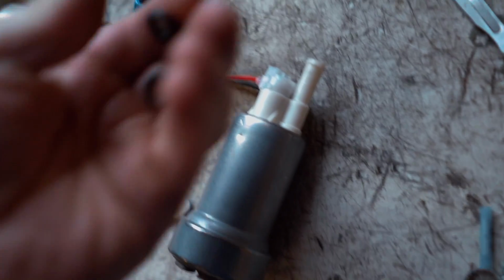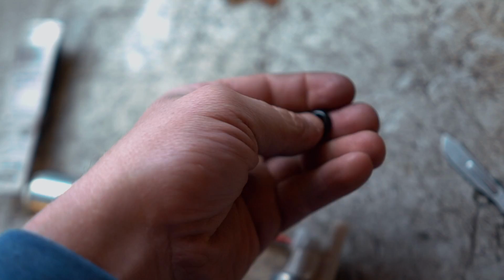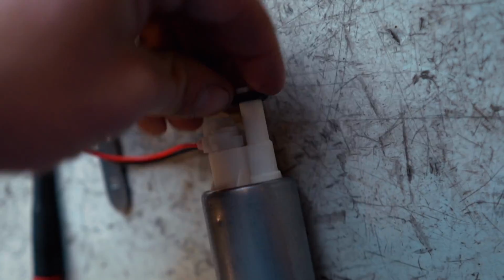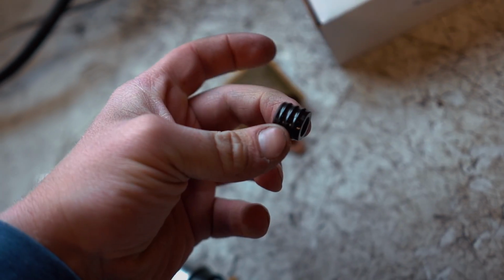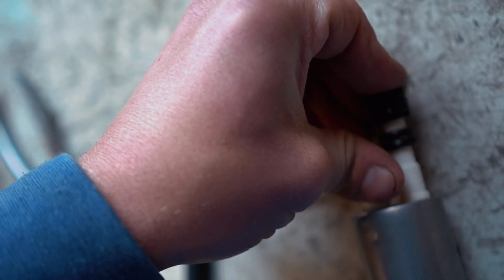So the next thing to do is take 2 injector O-rings right here. I'll try to find this exact size and link them down in the description box below. I'm gonna slide them over this right here. Should be a pretty tight fit. There's 1. Now grab number 2, slide it over, and then take this seal right here that was on our old fuel pump and slide it over the end.